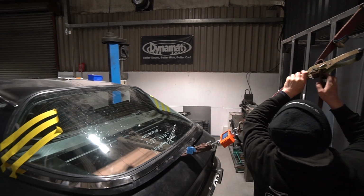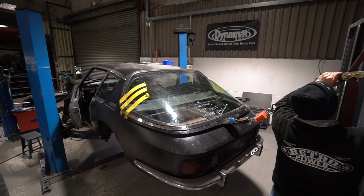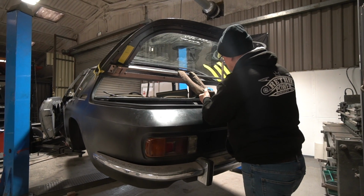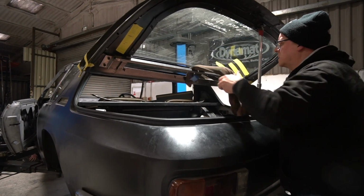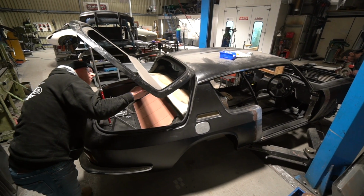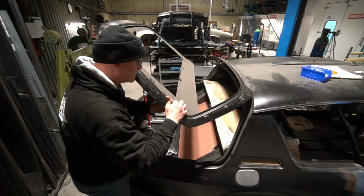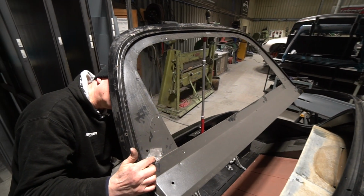So we've done that, and at that point Stu's been able to spec some gas struts and some nitrogen springs that will lift that tailgate correctly, hopefully. We've got a first one, and there can be some fine tuning if needs be, but we've got an initial spec for the gas springs that are needed to open the boot. He's now making the mounts for the gas springs that go under the tailgate, which is surprisingly flimsy with no glass in it. The glass is more structurally important on that than the steel work, to be honest.